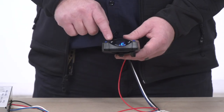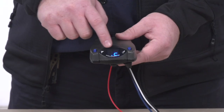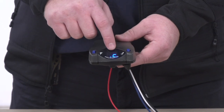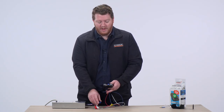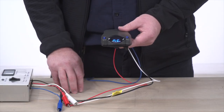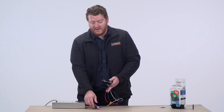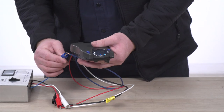Right here in the middle, we have our display screen. When you have this all plugged in and your trailer attached, it will come up with a C saying that it's connected. If you disconnect your trailer, it'll change from the C to NC, saying not connected. So if you plug in your trailer and you're having issues with it still saying NC, you know that it's not properly been connected.